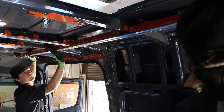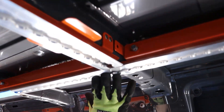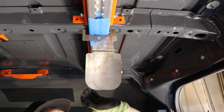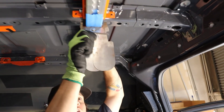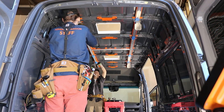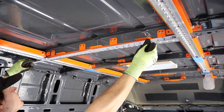Now install the actual ceiling bracers. Use the two tools per side that came in your kit to hold the bracers in place while you set rivets. The side of each bracer without a little adjuster bracket is the forward section. When installing, butt that bracket up to your forward ceiling rib since there's no room to adjust. Always favor the pieces forward. Use the kit tools to hold it up in place — they hook into factory holes in the van and have a little play back and forth to account for variation. Don't rely solely on the tools for placement; measure several times and adjust the track back and forth by about a quarter inch as needed for your specific van.